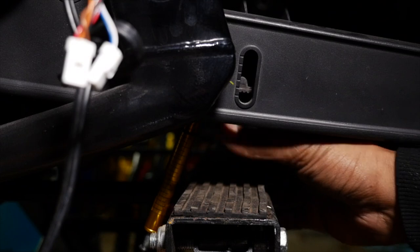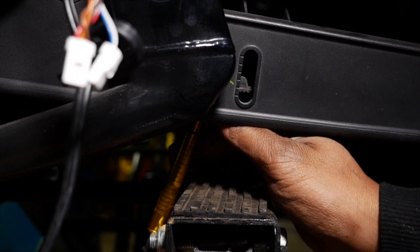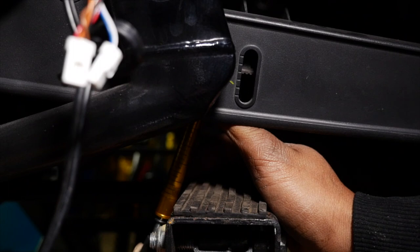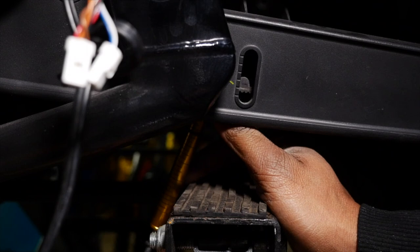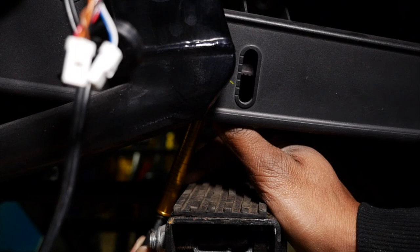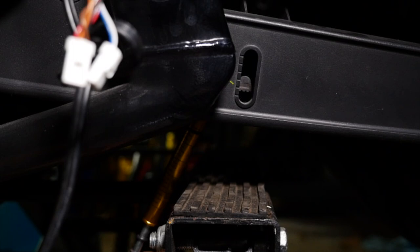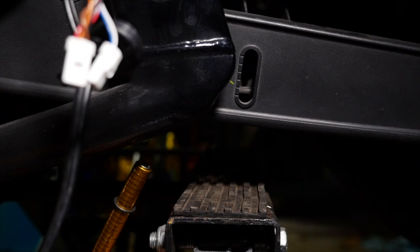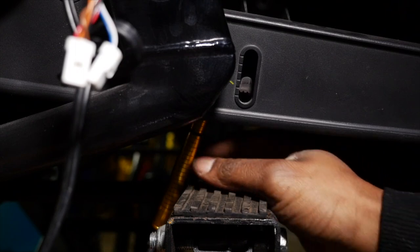Goes up about 2. That's what it looks like. All right. I'm gonna rotate the wheel and actually check it again. I'm gonna rotate it 180 degrees and just check it. That's about, it goes up about 2 there. From there on up to there, yeah. So that goes up about 0.40, so I'm gonna rotate it 180 degrees and check that.